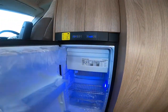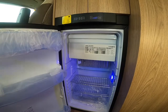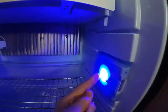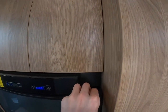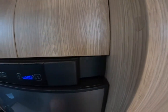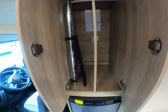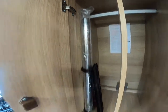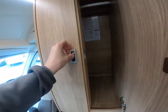When you've finished with the van for the season, always clean your fridge out. Then on the side of the light there's a little toggle — press it and two pins come out, so when you shut the door it's not fully shut, allowing air circulation in and out through the rubber seal to stop mould and bacteria growing in the fridge. Above the fridge is your wardrobe location with the hanging rail, your fire extinguisher, and the leg for your freestanding table — the pole goes into the floor in the back lounge of the vehicle.